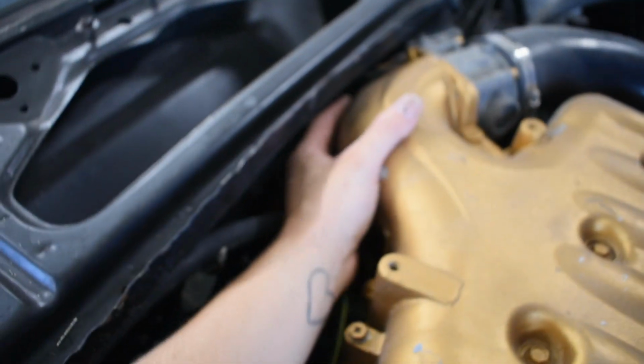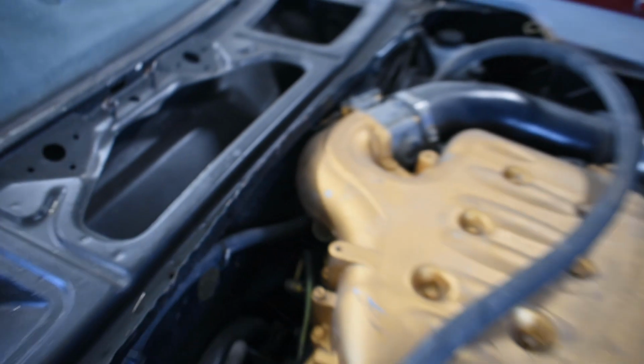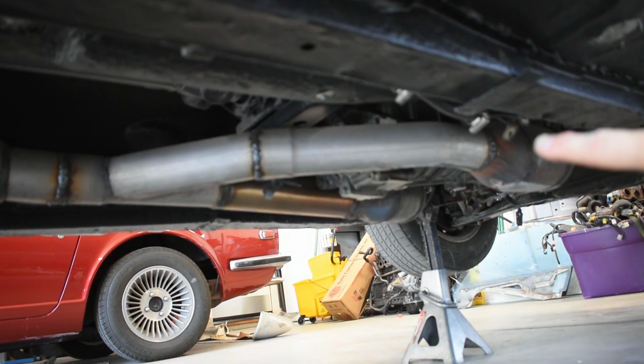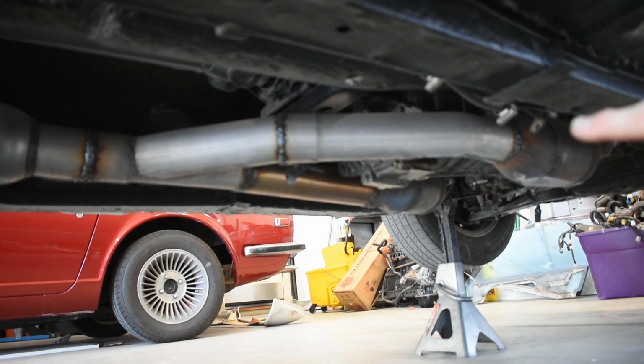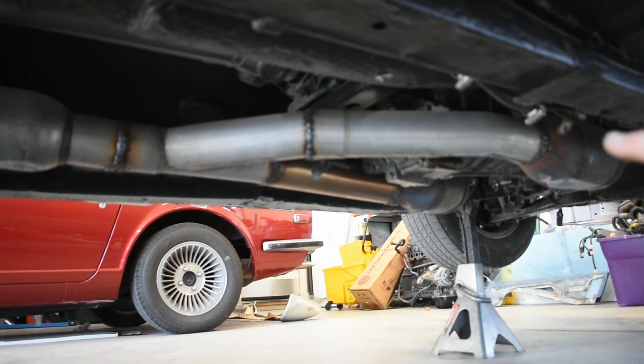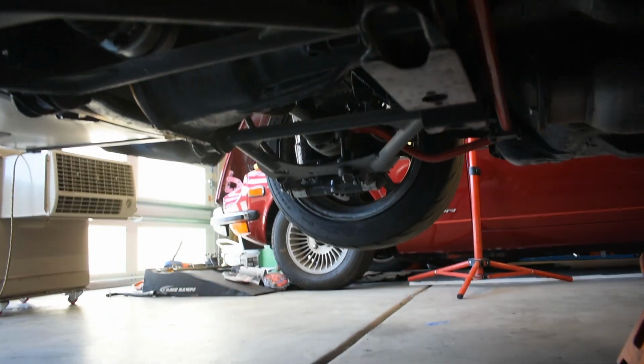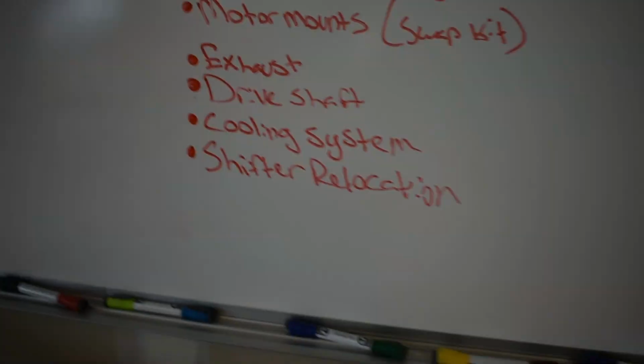Okay. And I've got our intake manifold very close. I can almost fit my finger between it. Now the exhaust is just temporary, but the end result will be very similar to this. This is just some catalytic converters I had, but the end result will be 2 high-performance catalytic converters into a Y pipe, into a resonator, and then I have a catback system for it as well. But I will be remaking all of that and videoing it.